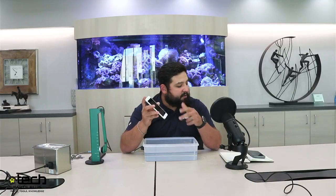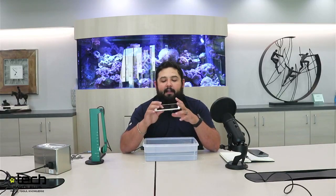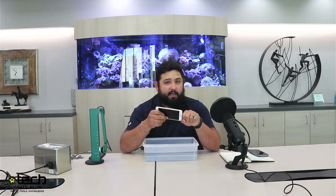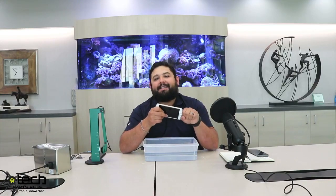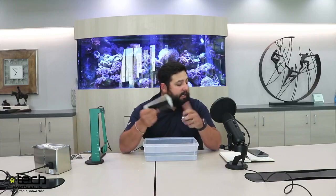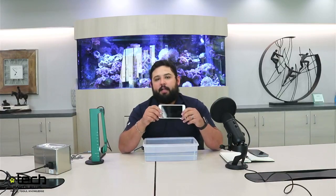So that's two. The next one, which is a very big one, is do not charge the phone. Because if you got lucky enough, the battery shorted out and is dead, so now the board can't short out. As soon as you plug a charger into that phone, you're now introducing live power into it, and that's, I would say, probably one of the bigger killers of a phone with liquid damage. So again, if you remember, turn it off, don't charge it, and then the last one is take it to a repair shop.